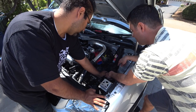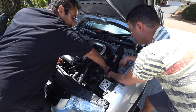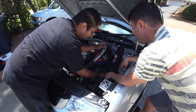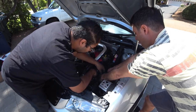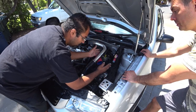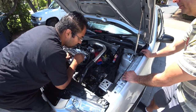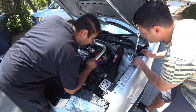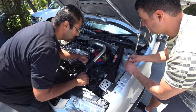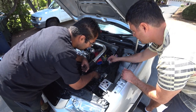And then again, check the tranny, make sure it didn't shift. Which it probably will. It always does. But this is why we leave them loose, so we can figure out the adjustment here. No, you don't need to move that. We just gotta see. So the transmission here is shifted about a couple degrees, because you're supposed to have it around here. And that's probably why it was snagging on his and on yours. Oh, back in the day? Mm-hmm. That's why it's all threaded right there, because they jammed it.